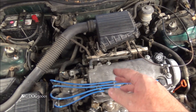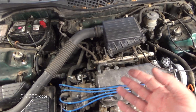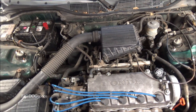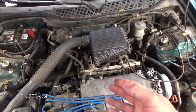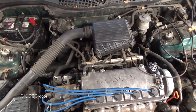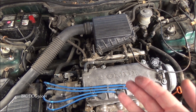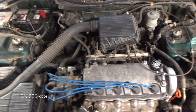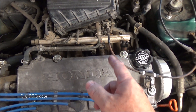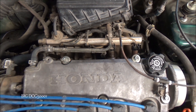Next, we need to disable our fuel injectors. Some models are out in the open like this one — easy to get to. Other models, not so easy. In that case, we may want to go to the fuse box and start pulling fuses for the injectors to disable them that way. If we have a newer vehicle with a bi-directional scan tool, we can go in and command the fuel injectors off. On Hondas, when we do that, we have to go back in and reset the PCM — something to always be aware of. On this vehicle, because these are out in the open, we can just unplug all four fuel injectors.